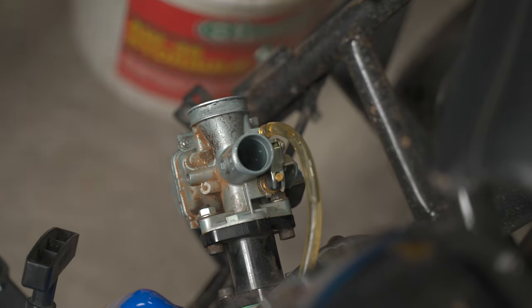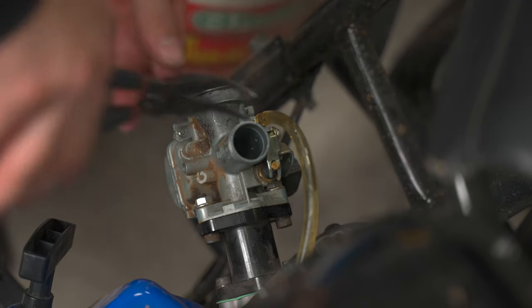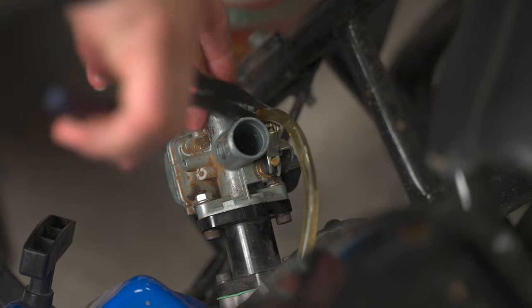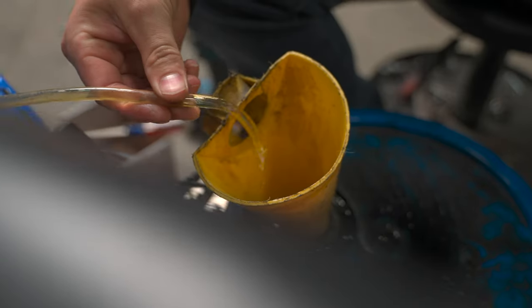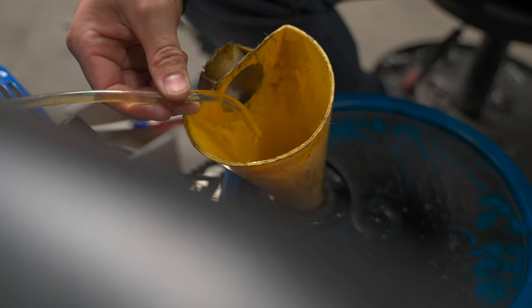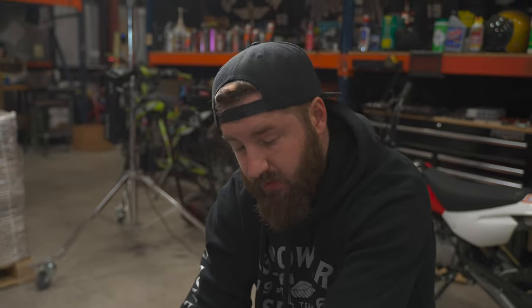Work it off slowly so you don't break your carburetor. I use pliers so you can pinch the end as well so it doesn't leak and make a mess. We're just going to let it sit here and drain this tank so we don't have to worry about old gas sitting in the tank. No point in cleaning your carburetor while still using old gas. This scenario works for methanol or any fuel that you're running — if you've let your carburetor sit and it's gummed up or has corrosion in it, just clean your tank. It's the first step of fuel going into your carburetor.